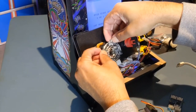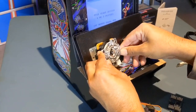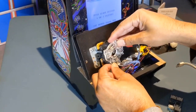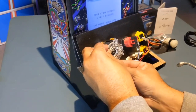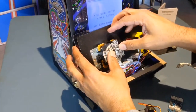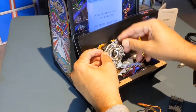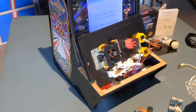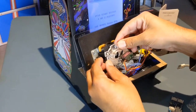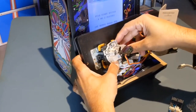The first thing we need to do is remove the standard restrictor — the one that came with the joystick. Again, this is not the Arcade1Up stock joystick; this is a Sanwa generic joystick I added to this mod. There are just four pins and you have to squeeze the black pin inward and then pull it out. Make sure you get the new one in the right way, because it takes more effort to get on and a whole lot more effort to take off.